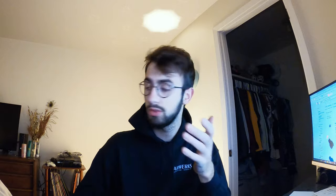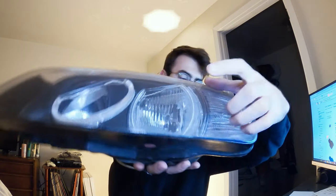So what I'm gonna do is take the circular lens that's inside of here, this guy right here, and then I'm going to 3D scan it or measure it up best I can. I've measured them in the past and they're a little bit hard to get the shape right, but I'm gonna probably 3D scan it and then emboss the StanceWorks logo into it, and then print it out of clear SLA, and hopefully cover that with some sort of UV resistant resin or coating, so that way they don't yellow.